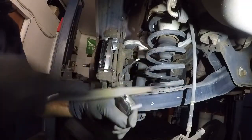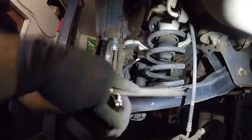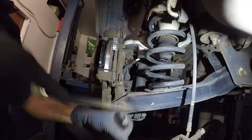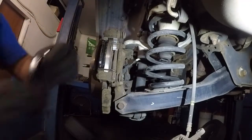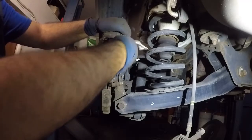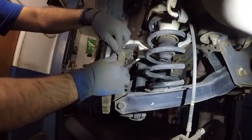And that should be it, okay? I just don't want to have those brake pads in there super tight. That's not how this is supposed to be. They need some kind of free play so they can back off when you're not applying the brakes. Right? And I'm going to put this back in there again. Hopefully this time is enough, and if I'm happy, I'm going to leave it there. If I'm not happy, we're gonna file some more. And there you go. I'm happy.